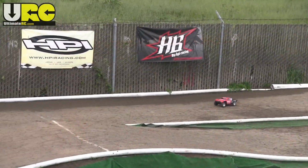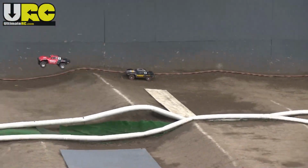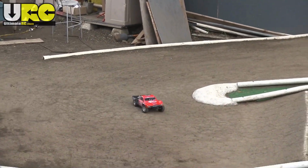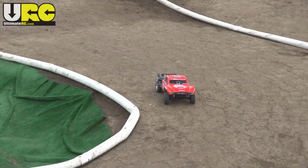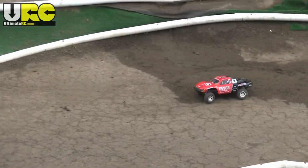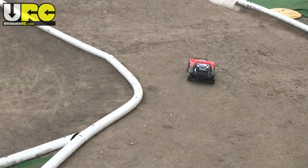Fresh out of the box on the first charge of the included battery, this truck topped out at 22 miles per hour. Once the battery and motor both break in, you can expect more around 25, and with a 2S LiPo it might go a hair higher than that. And that's with the default gearing, which is safe to run continuously under most conditions.